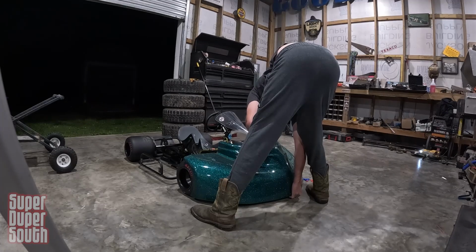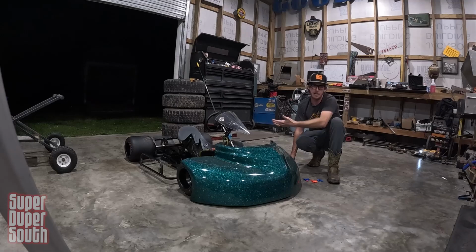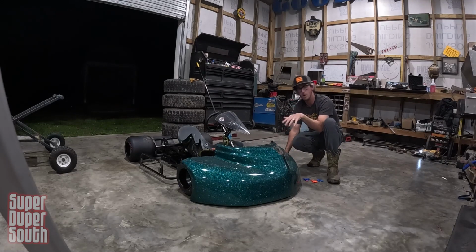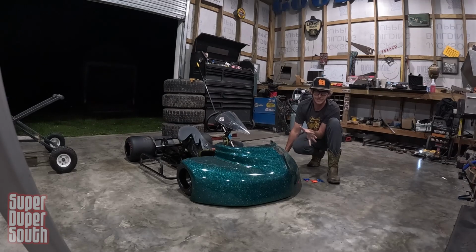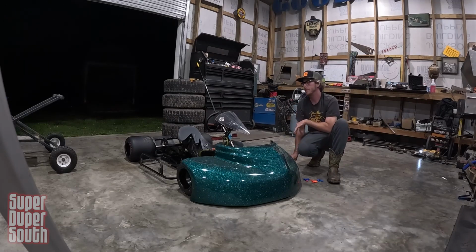Once you get on your table or your plane, it's good to always get a half inch piece of plywood and shove it up underneath the nose, because roughly you're going to be about a half inch off the ground after the product's said and done. A lot of your newer frames have adjustable deals that go up and down anyways to get your right height. But I typically go with a good half to maybe five-eighths on a bumpier track, because sometimes the tire hits a bump, the nose goes down, scrubs speed, rubs a little tiny hole in the bottom, and then you're complaining.